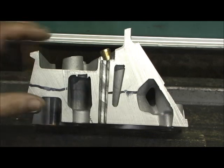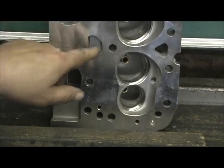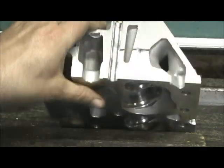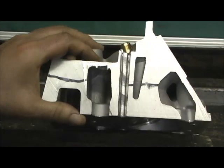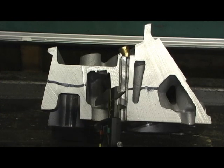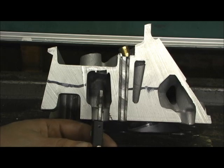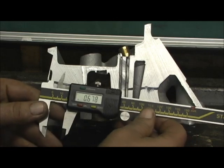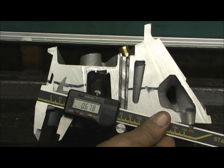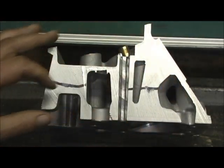Now look here — remember where that was. That was our deep water pocket. This is right up underneath the port, and this is a water passage here. So let's see what kind of thickness Pro Max gifted us with right here. Got my trusty old caliper. This head has been milled a few thousandths, and I'm coming up with 678 thousandths. So it was probably around 700, which puts it in the category of three quarters of an inch of deck thickness on the cylinder head.